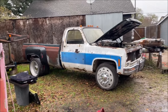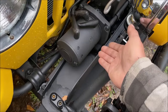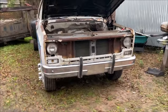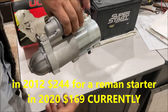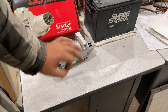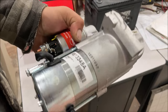They were $38–$40 for many years with lifetime warranties. The older starter motors are pretty much the same size as an 8,500-pound winch — starter motors were bigger back then because engines had lower compression. On these LS motors they put a tiny little starter on them, and in 15,000 miles this will be the third starter going on this truck. It makes no sense for them to keep going bad.